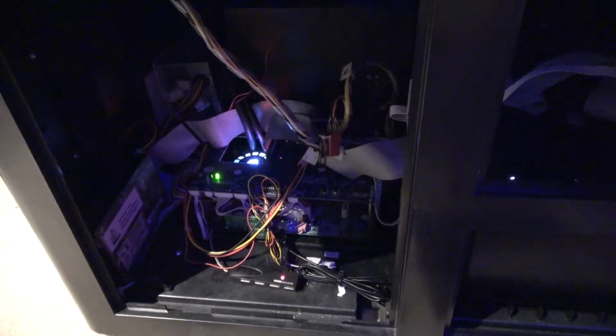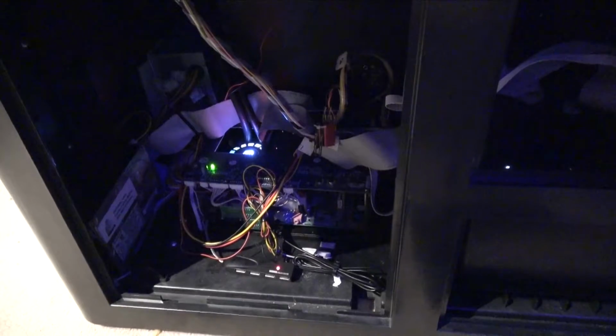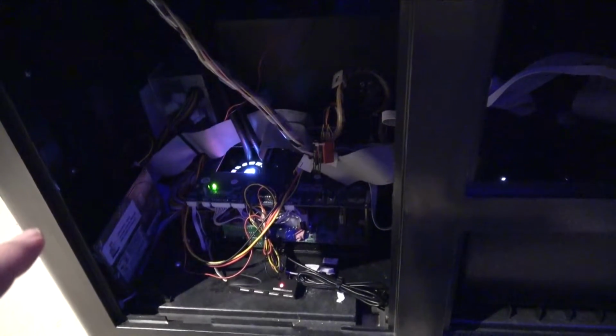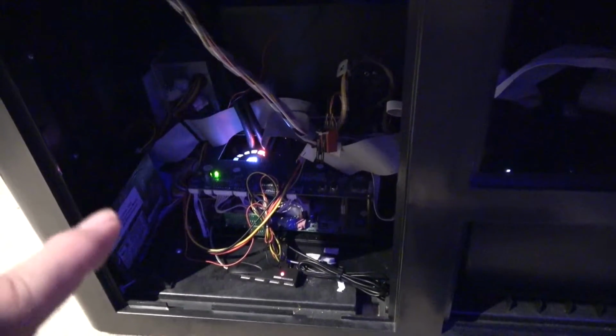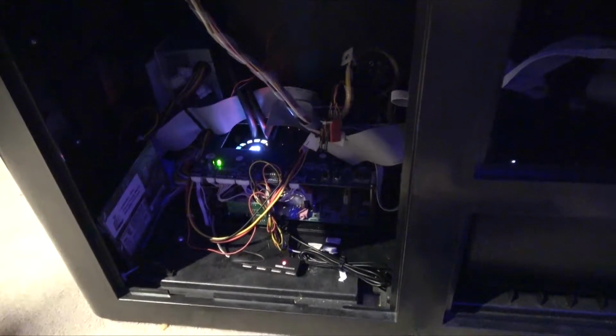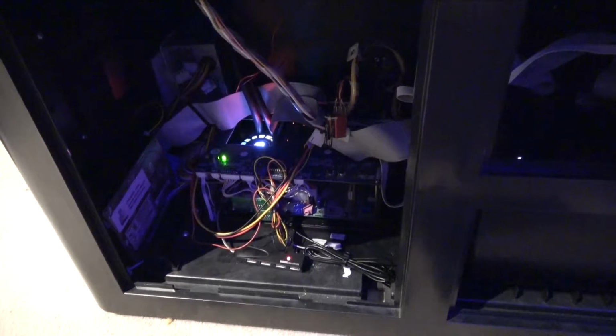I didn't need to put any more RAM in there. You can actually upgrade the RAM, I think, but that's not really necessary. But the processor, definitely upgrade that, put a water cooler on it. That water cooler I had to mod and chop up a little bit because you can't actually get them to suit a P4 socket, but if you get one of the later ones you can modify those, just drill a couple of extra holes in, and then you can fit it on there yourself.